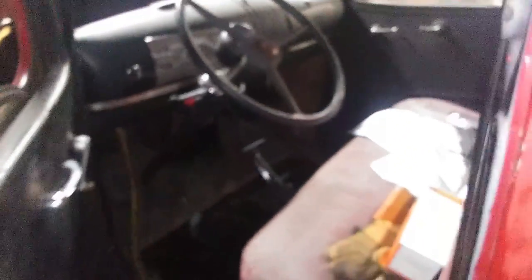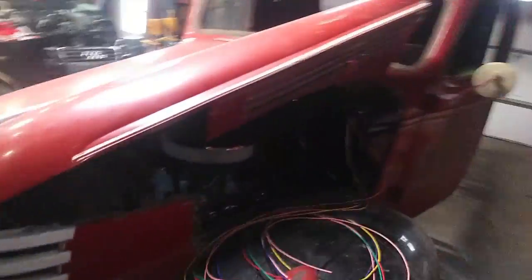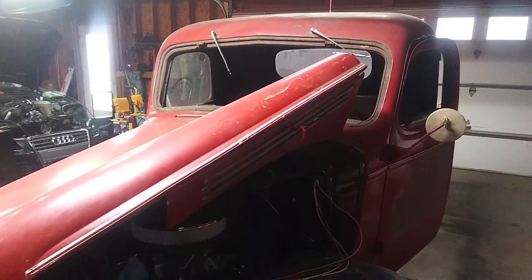One thing that did take a lot of time was, if you can see these guys, they are called clutch heads, and they suck because they strip out very easily if they're rusted in, and that's pretty much what's used all over the inside of this truck. It involves a lot of drilling out and cutting and all that good stuff, which is obviously time consuming and not fun. So it took a while to get them out, but installing them was pretty easy, and I just used regular Phillips heads for that to save time in the future in case it happens again in 70 years.